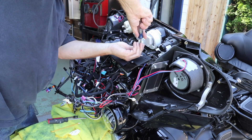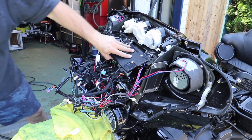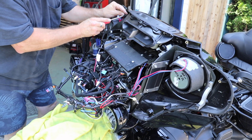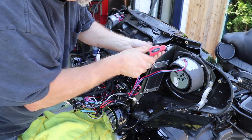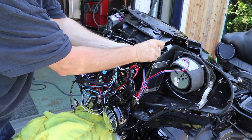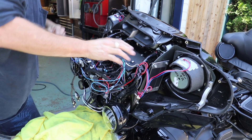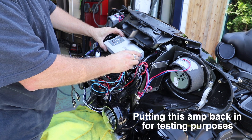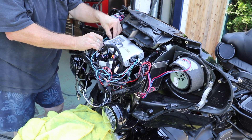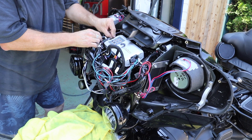These screws here — the ones that come from the kit are 3/8 and they are only meant to hold the original tray down, not any extra plates or poly or aluminum, whatever you're using to hold your amps down. You'll have to use your own screws. I'm using quarter-inch steel stud screws. I finished plugging this amp in and I ran through the initialization process for the hand controls with the boxes that came with the kit, and it went flawlessly.